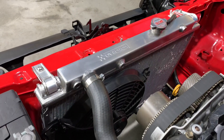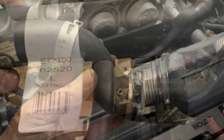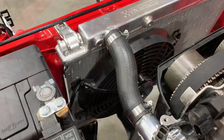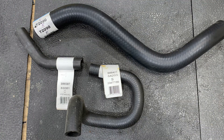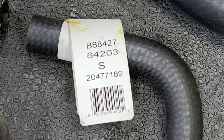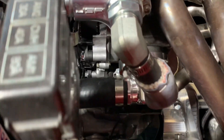Next we're going to cover the radiator hoses themselves. All of these part numbers are going to have the right diameters and the right bends, though some of them are going to need to be trimmed to be the correct length. This upper radiator hose will work both with the JSP upper neck as well as the OEM upper neck — it's just a little bit of a better fit with the JSP part. You'll also need to pick up the lower radiator hose, the thermostat bypass, and a looping hose that connects the upper heater outlet from the back of the engine to the passenger side of the heater core.